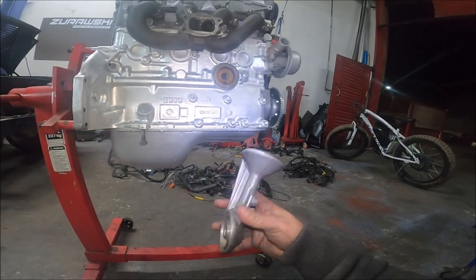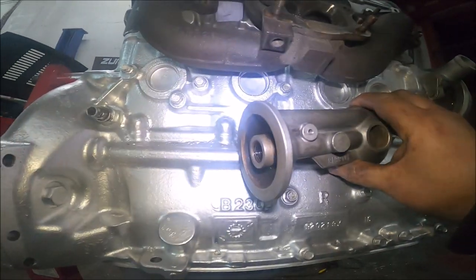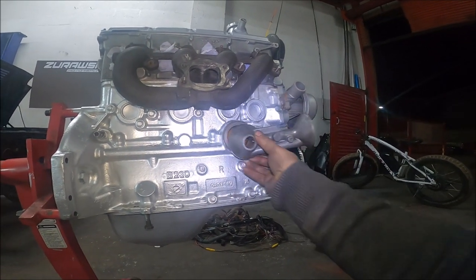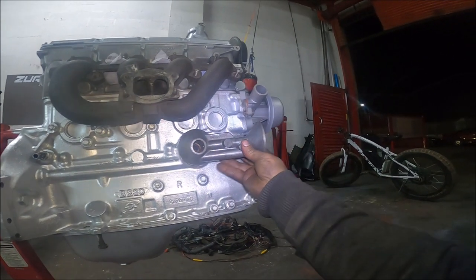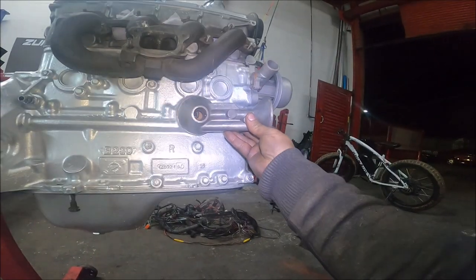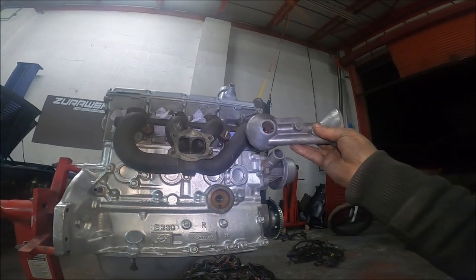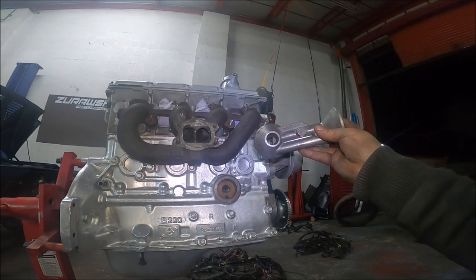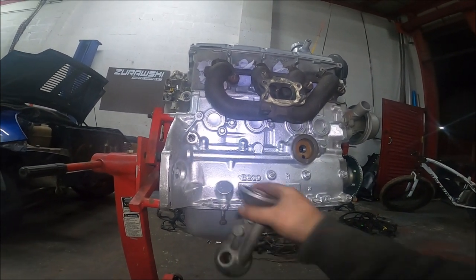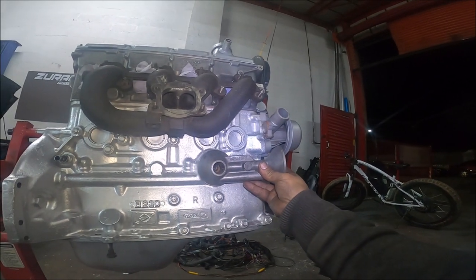This is the standard extension bit — it normally goes roughly like that, and then you've got the cooler and the filter. This could go 360 degrees, but where it would clear things I don't know. I reckon maybe like that, because there's no alternator on that side anymore. That is where the engine mount will be, so that might work — but that will depend on turbo position, because I need the link pipe to fit, the turbo to fit, and the oil return which has to go back to the sump. On turbo cars it normally goes there, which means drilling the block for that.